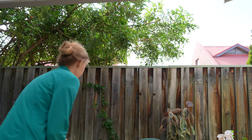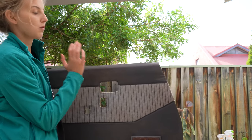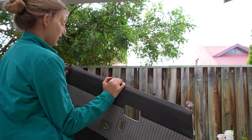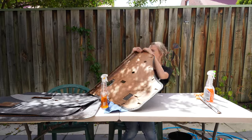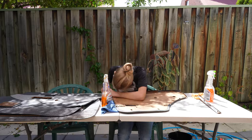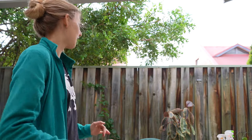After breaking a bit more vinyl, I've had a bit of a think. I'm going to keep these bottom three layers of the door card — fabric, vinyl, carpet — and replace the top one with new vinyl because this is a really brittle section that keeps cracking. When I do that, I'll maybe put some foam underneath as well so it's a bit nicer to lean your arm on. The priority for now is to get these covers off the door cards without damaging those bottom three layers, so I can remake those door card templates and build the rest of the cover using the door card as a base rather than one big sheet that just goes over it.